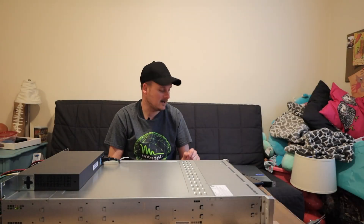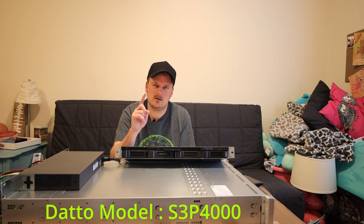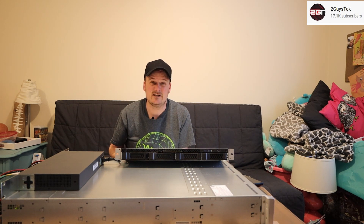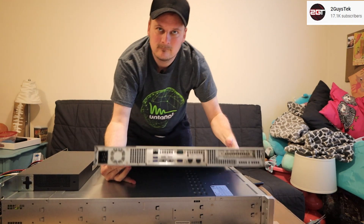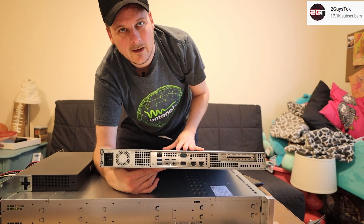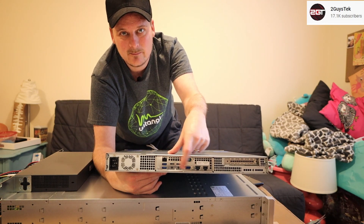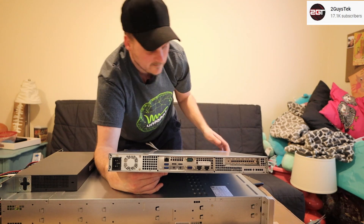Part two: I want to show you guys this — it's a Datto box. It's a 1U Datto with a 16-core Xeon D in it and 16 gigs of RAM. I threw in some cheap drives just to play with it and bring it online. On the back we have IPMI and two 10 gig NICs. I thought they were 1 gig NICs when I got it, but after reading the manual it's got two 10GBASE-T NICs on board. I'll show you what it looks like inside.